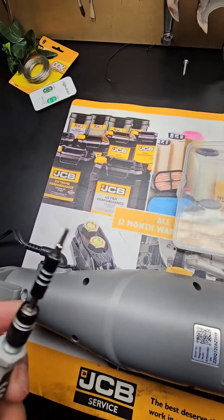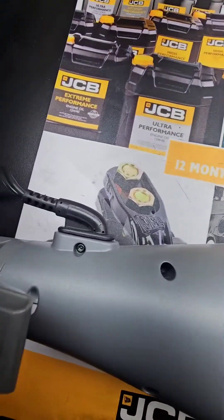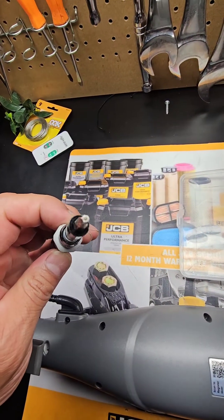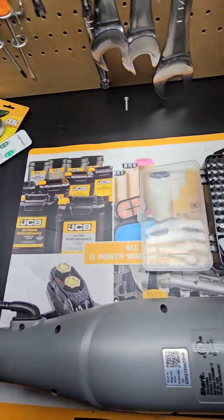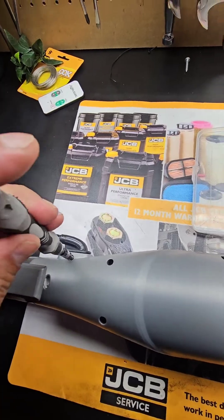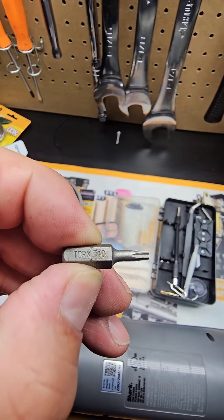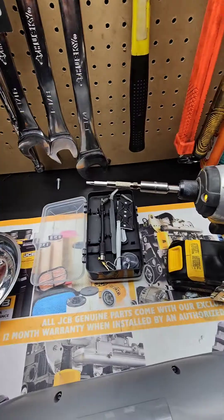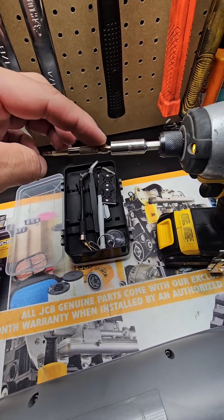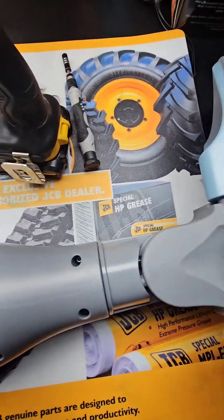It looks like it's a size 7. I don't even know what you call these - it's like a little bit with a hole in the middle. You can see these screws have a little pin, so you need one of these keys with a little hole in the middle. It's a Torx T10. So to get all the screws, I just use a Torx T10 and an extension with my driver and got them all loose.